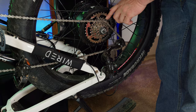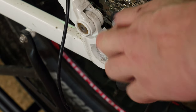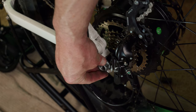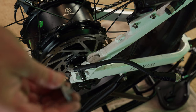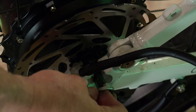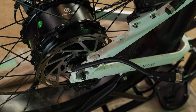Put that washer back on, and the torque nut — or whatever the heck that thing's called — back in there. Pull up the chain: you're going to have one part of the chain on the top of the cassette and one on the bottom. There are flat parts on the axle that line up to the flat part in the dropout, so sometimes if you just wiggle it back and forth it seats. Make sure the rotor goes through the brakes on the other side. The cassette side goes right on with no washer underneath it. On the brake side, we have the washer — make sure the tab matches the tab on the frame, stick it on there, and it's all lined up.